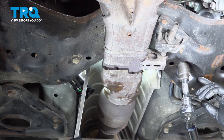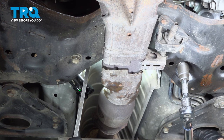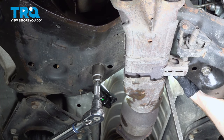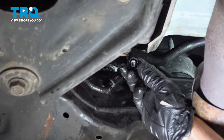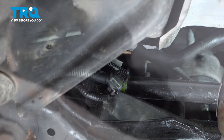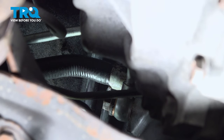Foot-pounds, you're going to torque the two main bolts that hold the rack to the subframe, 21 millimeter wrench and socket. Now we can plug the electrical connector in on that rack until it clicks. Now with a 14 millimeter socket, we're going to tighten up that pressure line on that banjo bolt. See if we can get in there at any angle.